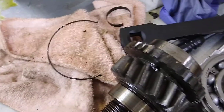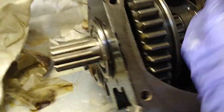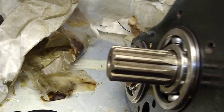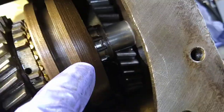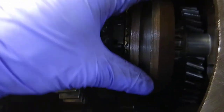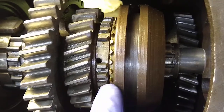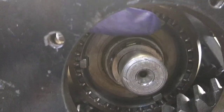First time I got this reassembled, I screwed up a little. As I was pressing the bearing back in — this bearing in the back — it's not super tight. So as I was wiggling the transmission around, it kind of loosened its way out and slid out a little bit, and it caused the main shaft to slide away from the clutch gear, and my needle bearings fell out. So I had to take everything out again and redo it. Another screw-up I had was with the third-fourth synchronizer cone — it has these little clutch keys, three of them, that go all the way through to the other side of the hub.